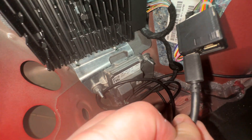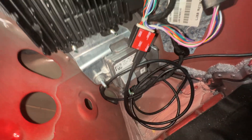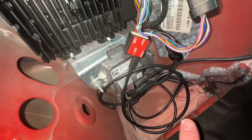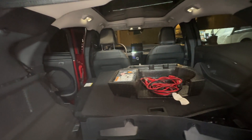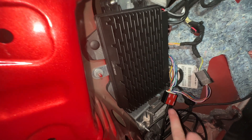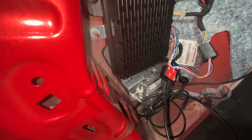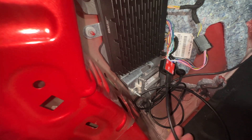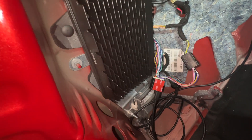Now this box communicates over the USB-C cable — and by the way, that is not just any USB-C cable, only very specific USB-C cables work. The USB-C cable goes all the way up front to the Comma 3X mounted below the rearview mirror. Commands come out of the IPMA, come into here, go down the USB-C cable to the Comma, it intercepts them, changes them to what it wants them to be, sends them back down the USB-C cable, and then out to the steering wheel.